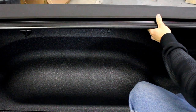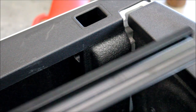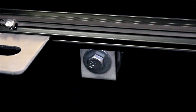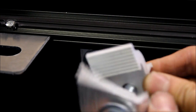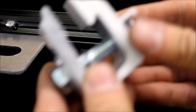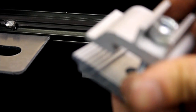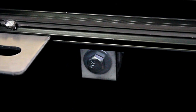When you're doing this, make sure the tailgate is closed. Now you're ready to install the clamping system. Basically, this clamps the bottom part of the railing system onto the actual bed rail — it's grooved because there are grooves in the bed rail itself, so it hangs on. All you need is a socket wrench or a gear wrench to make your life easier, since they've already countered the nut on one side. We're just going to snug it down for now — not super tight until everything is in.